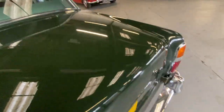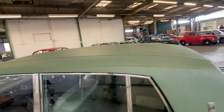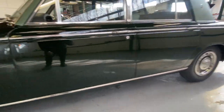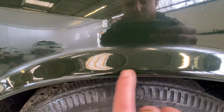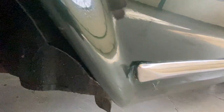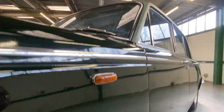There was a little bit of a burn through that I missed on the leading edge on the boot there. Going down the passenger side, the roof is all okay. That chrome bit wants sorting out. A few little marks on the passenger front door, the leading edge has a little chip here and there, but a couple of paces back it's nice and presentable. The passenger front arch has a little bit of a burn through and a few little blebs in the paint, but it's all nice and straight with no rust coming through. A few little scratches underneath the reflector, all nice and straight and clean down the side.